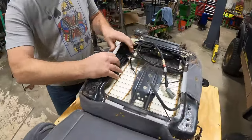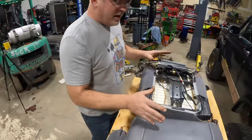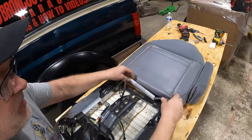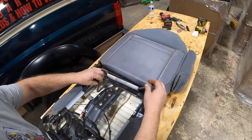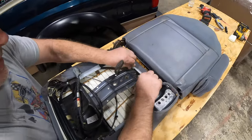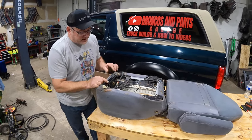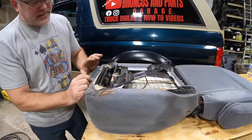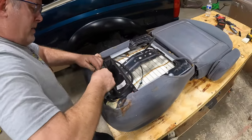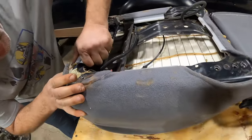Come around the other side — push and pull it. Now let's do the back. Make sure it looks even and your cable's covered, that you haven't disconnected any of your lumbar. Roll it and snap that in place. Now we'll do the front of the seat — we do this one last because it's the hardest. It has a different profile for the J hook that has to go all the way around and catch. Bear with me — this one I've always had trouble with.